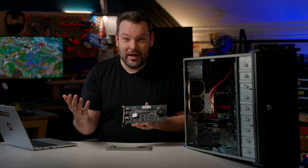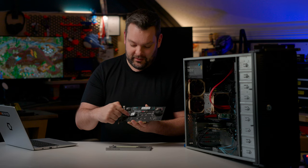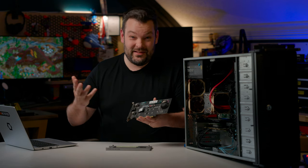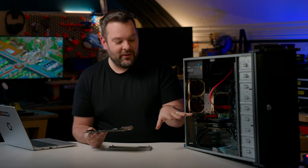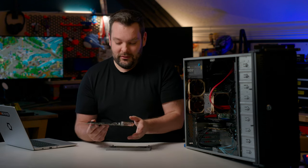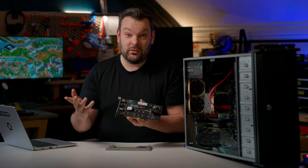The idea was to put this card in the top slot and have 2x 2TB drives with a couple of other NVMe SSDs. This Toshiba 2TB I found on serverbuilds.net — enterprise grade, very high write endurance. But the first problem was that the bifurcation on the first slot of this motherboard only goes as granular as 8x4x4, whereas what I actually wanted was 4x4x4x4. That would mean these two slots show up as a single 8x, and then the two 4x slots are individually addressable.